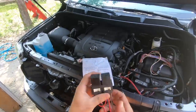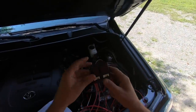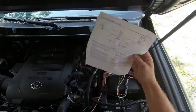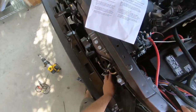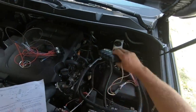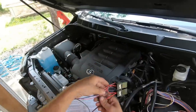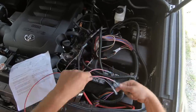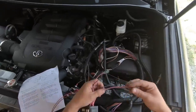On the last step when you're putting in your wiring system, you have to put in this turn signal relay kit. What this does is slow down the turn signals from blinking so fast. I just got off the phone with Boss technical support — the way this reads is misleading. You want to find your pink and purple wire — they call them pink and violet. You're going to go back in your corrugated area and pull out your pink and your purple and splice into them. We're going to connect butt connectors: purple with a yellow line and pink with a yellow line. This goes on the downside towards the plug end for the plow, and without the stripes it goes to the wire end towards the relay.